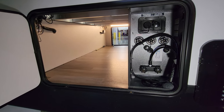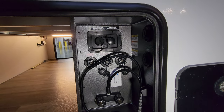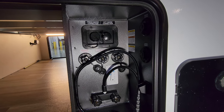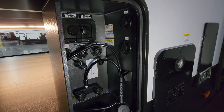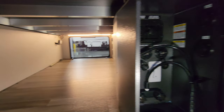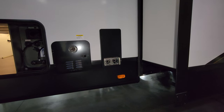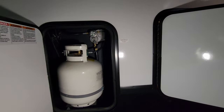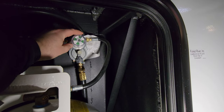On the other side of the pass-through storage compartment is your docking station area. You have a gravity fill fresh water tank, city water inlet, black tank flush, winterization valves, hot and cold outside utility shower, and cable inlets. Right here you also have the on-demand water heater exhaust and furnace exhaust. The other 20-pound propane tank is on this side along with a dual-stage auto-changeover regulator — you twist it to pick which bottle you want to start with, and it automatically switches when one runs out.